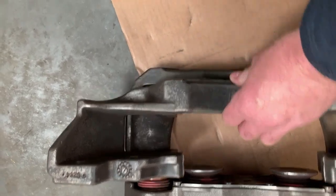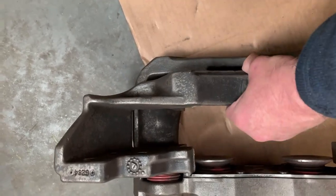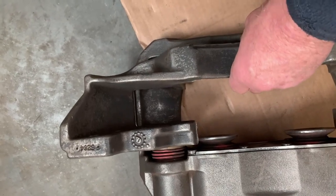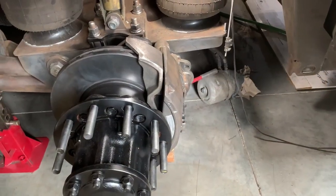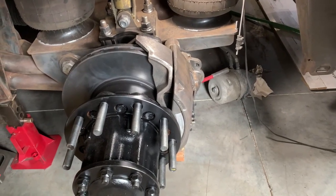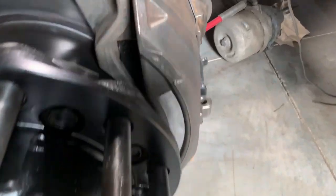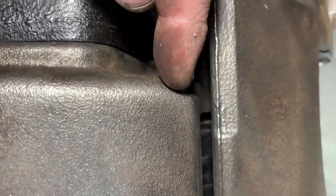When the brake pads are out, you've got an awful lot of travel on this caliper. As you can see from the other video, I had that much travel - it wasn't anything. Here we have the caliper installed back onto the coach temporarily with two bolts, tightened up, to show the right fit, finish, and movement. This one's got the new brake pad in just to show you where it sits.